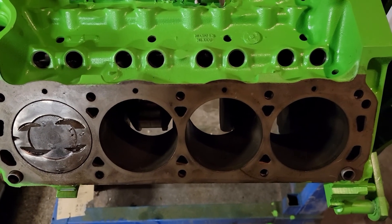I didn't want to use the stock valve covers, so I went ahead and ordered a set of chrome valve covers. They were kind of pricey — the cheapest ones I could find anywhere were $99, so 100 bucks for the pair, 50 bucks a piece. But they have the tall profile and they're baffled. I definitely want baffled ones because at high RPM they'll throw all the oil up top of the engine right into the catch can, and I don't want that.